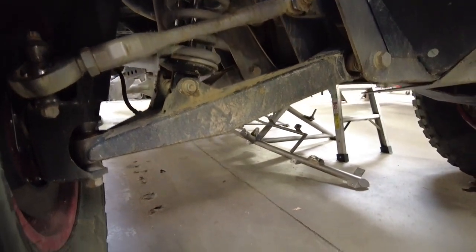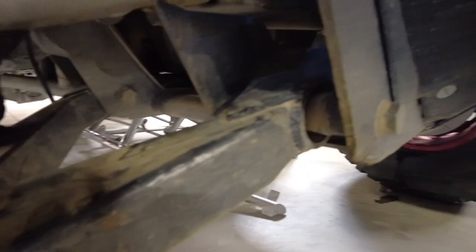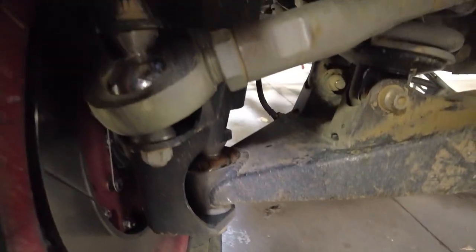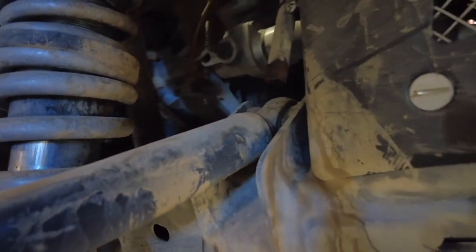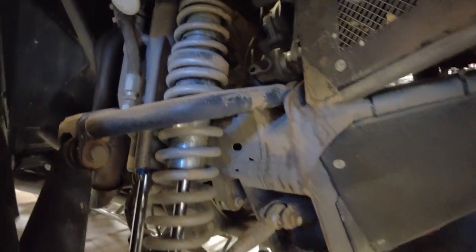Full long travel kit. Got the box lower arms, 1-inch uniball Heim pivots on the frame, 1.5-inch uniball down on the spindle, full Heim steering with 1-inch FK rod ends and uniballs, 1-inch uniball up on the top, pivoting on the FK Heims at the frame. It's a 2.5-inch coilover, 3-inch bypass in the front.